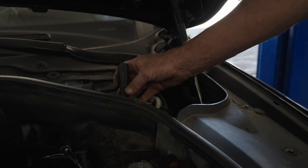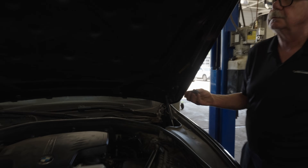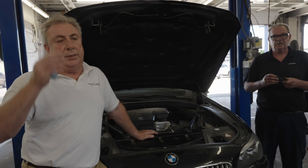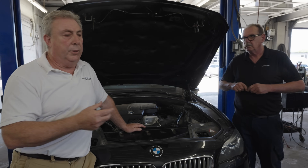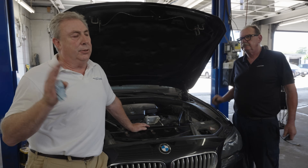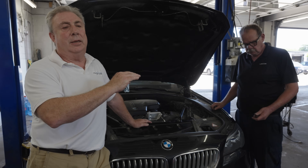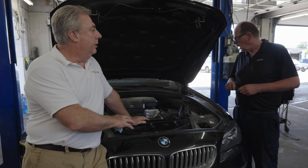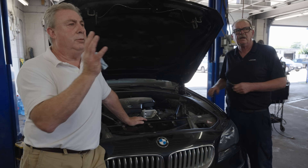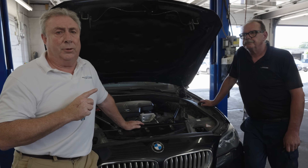Does it give you a percentage on that, John? Yeah, that should be about 10% water. So the cutoff — we call 3.7% the general mark, the cutoff point for good hydraulic brake fluid versus wet brake fluid. Wet fluid means you've got to change it now. This car is a 2015 — doing the math, that's almost 10 years — probably original brake fluid, and we can see it's crept all the way up into the danger zone at 10%.